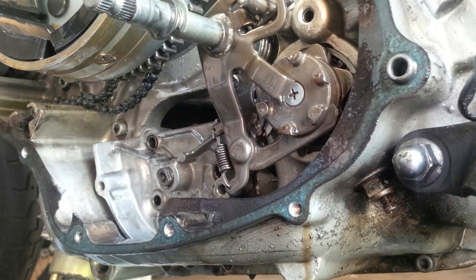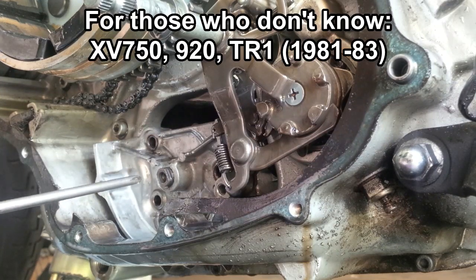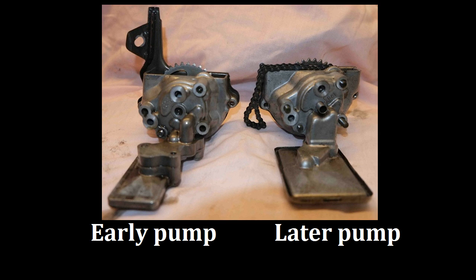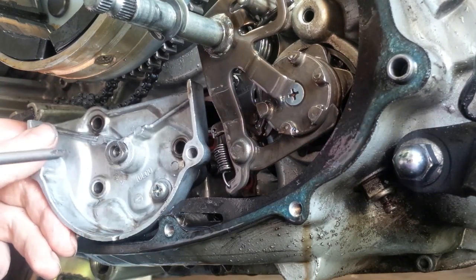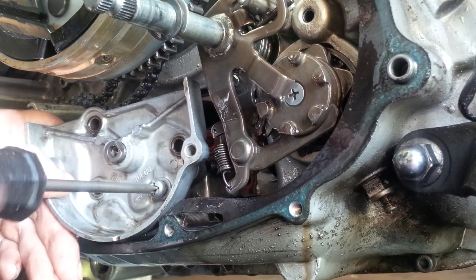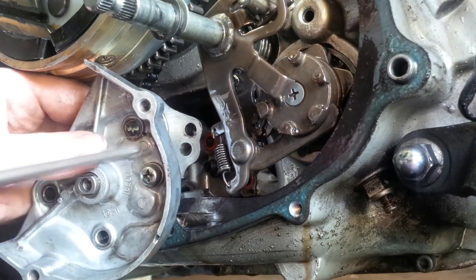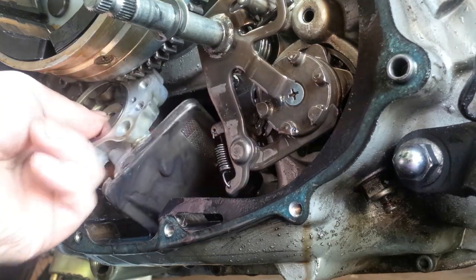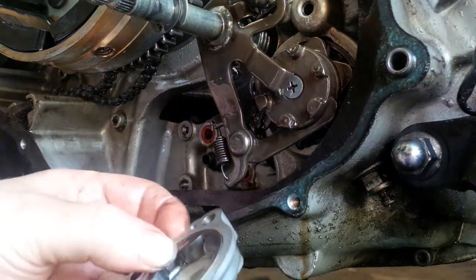So the thing is I made a mistake. The last time I did this it was a first gen — a 750 from '82 or something. With those ones this thing comes out nicely because the strainer on the inside is much smaller on the first gens. Now with the second gen, you also have to undo this — you have to remove this completely and dismantle the pump, which is a bit more labour intensive, and you expose the moving bits inside the pump.